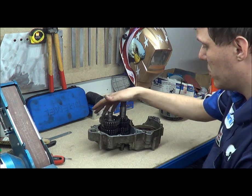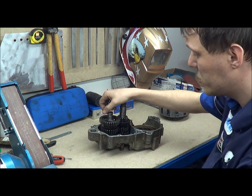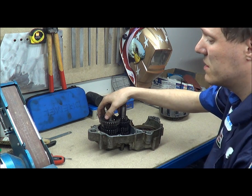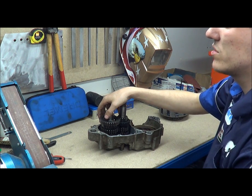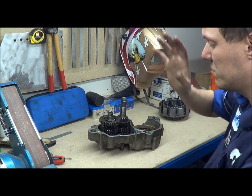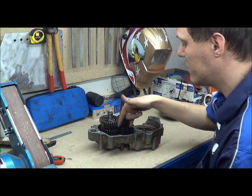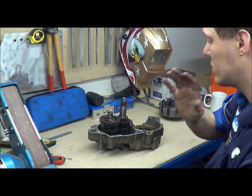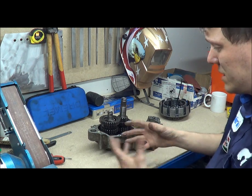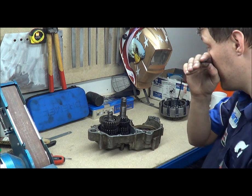So basically all there is in the gearbox: there's an input shaft and output shaft, gear pairs — and gears always have to be in pairs. If you have one gear turning on its own, it's just literally a turning gear. You also have the selector drum — another video we'll get to that. We have the two recesses for the guides for the selector forks. And basically the rest of the housing is just to hold the bearings. And that is it.